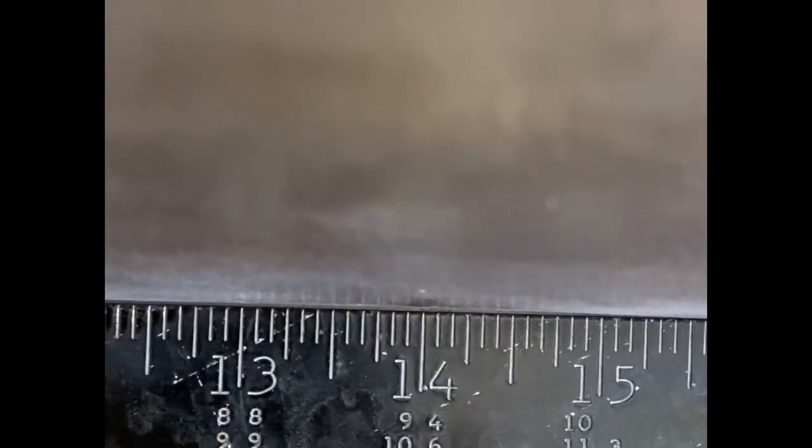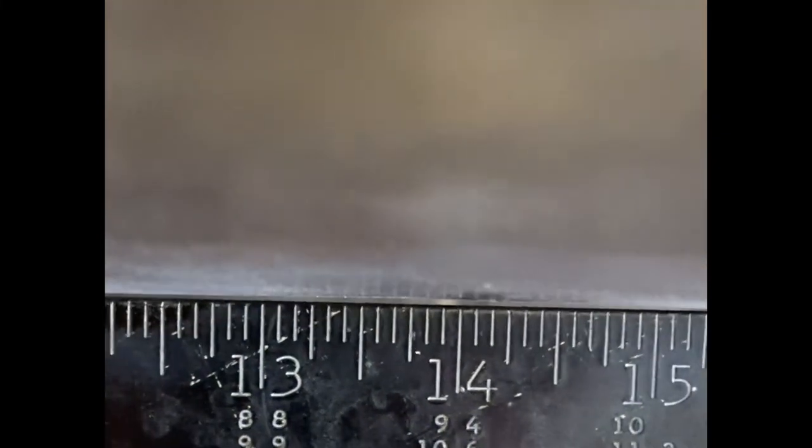It twists and pops off. Right here where I cleaned up the metal in this vertical area is where the dent was — about an eighth of an inch deep. Watch as I pull this ruler right along it — there's really no gap there anymore. Just a bunch of little spots, and you can see where every spot welded itself on. Very small little imperfections in the metal that would easily get sanded off. I'm not pulling so much in one spot that I'm crowning and creating huge mountaintops. It's actually going to be on the over side, so even if we hit it with some sandpaper real quick — look at that, beautiful.